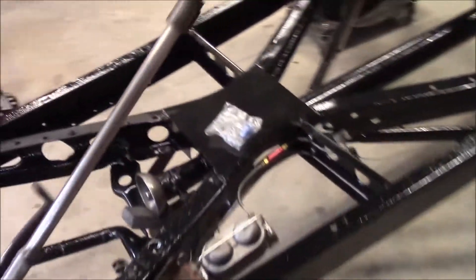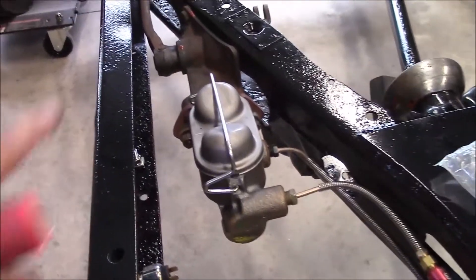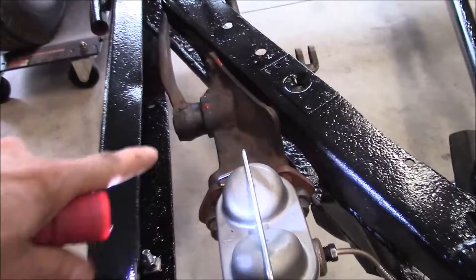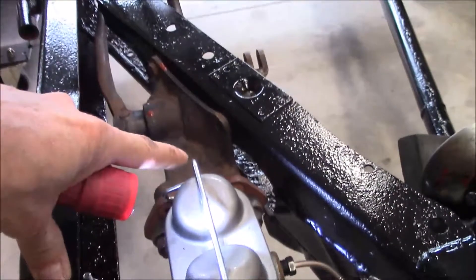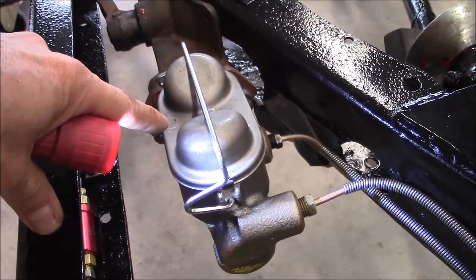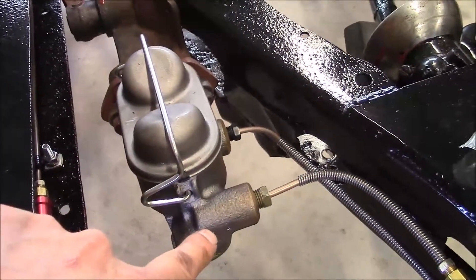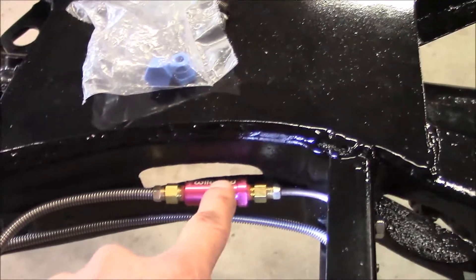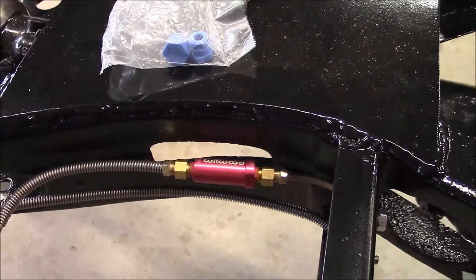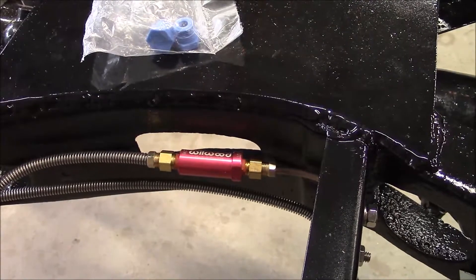I got all my brake system parts installed — I'm going to remove all that and paint it, but I installed it so I can get my brake lines run. I used the original 1939 Ford brake pedal assembly with a little adapter off eBay that adapts a dual master cylinder. This is a 1967 Mustang dual master cylinder for drum brakes. It ended up not having the residual valves internally, so I had to buy aftermarket 10-pound residual valves for the front and back lines. That'll help keep pressure on the front brake drums and override the retracting spring pressure, so you get a little better pedal feel.